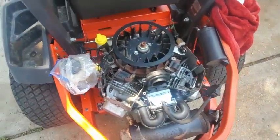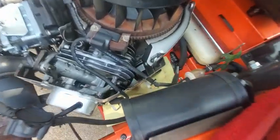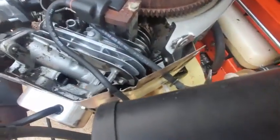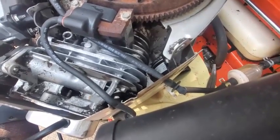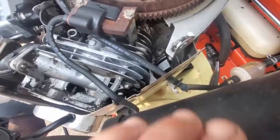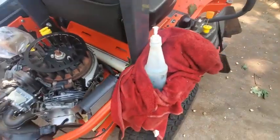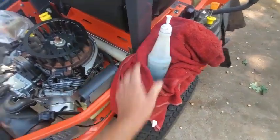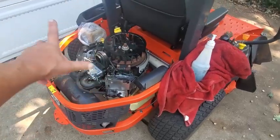And it's got an oil leak. Trying to find out where exactly this leak's coming from. The owner is telling me that after it runs for a bit, and after shutdown especially, it comes out around this oil filter area. What I did yesterday was I used just a mixture of water and Dawn dishwashing liquid and just sprayed the heck out of it.